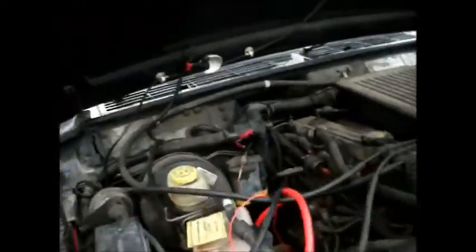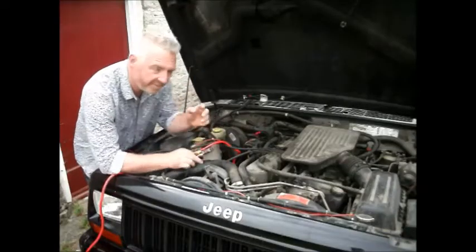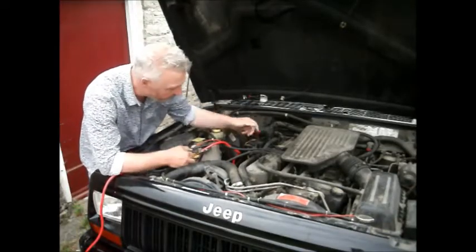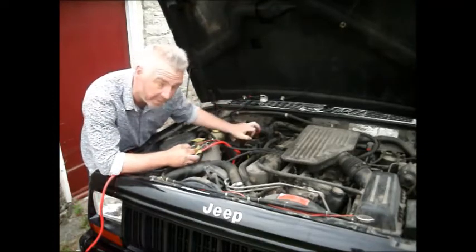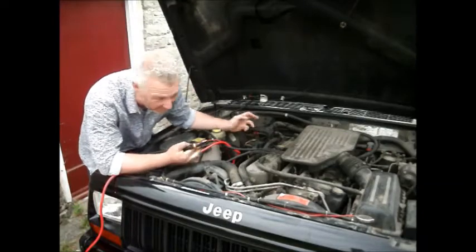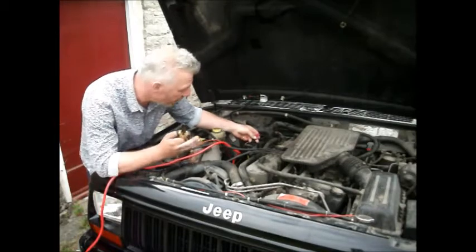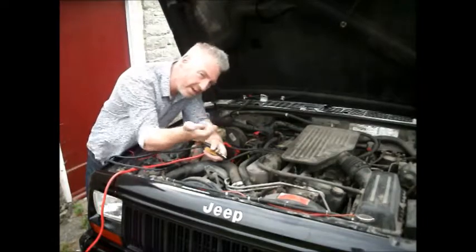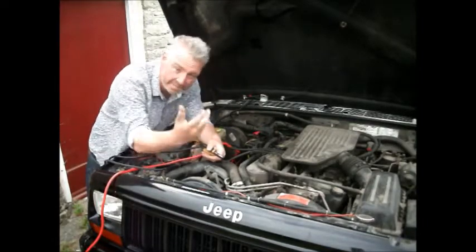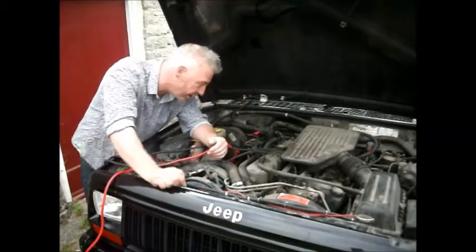Now the siren, you can see, is here. It's this beast here, and it makes a god-awful noise. Now after I rashly cut the cable and then found that I couldn't get the thing to start, I thought I might just disconnect the sound. I've reconnected the wires here, but it's not working, and I suspect that's because the alarm unit itself, once the circuits inside it have been broken, needs a proper resetting procedure, and obviously they're designed that way to stop people stealing the cars.